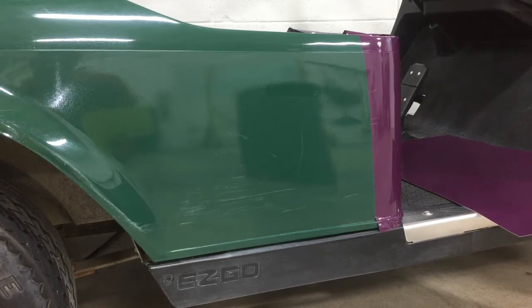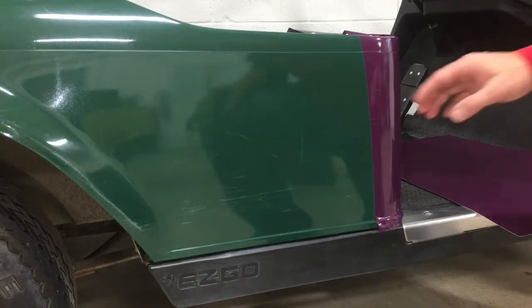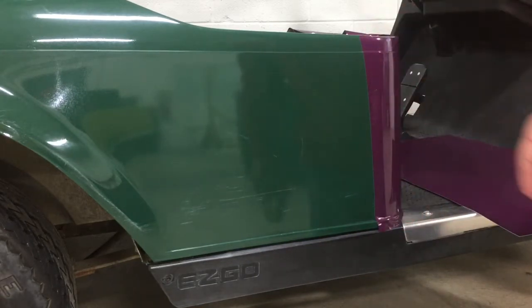This is pretty much standard procedure. In today's demonstration, we've already got our center under-the-seat panel installed as you see, as it wraps around the corner. We're going to give you some techniques on how to start the next panel, which would be the side panel or passenger side panel that goes over the wheel well area. The first thing you'll probably want to do is straighten up your edge. A lot of times as you wrap around the corner, you may get a few wrinkles as the material comes around and your edge is a little bit on an angle.